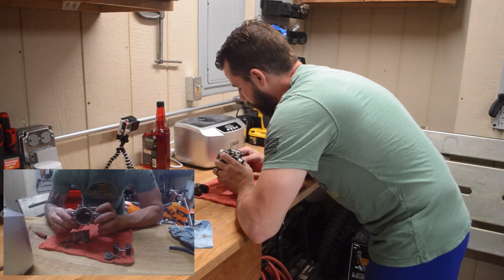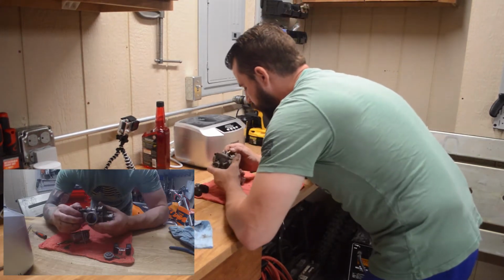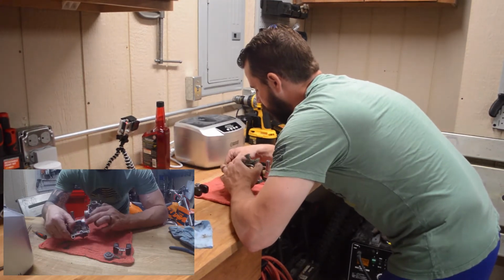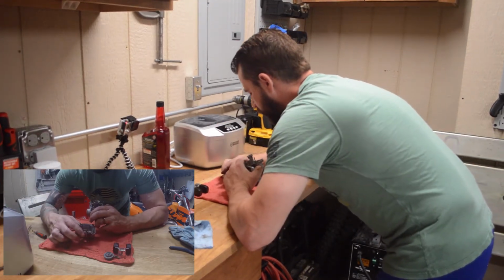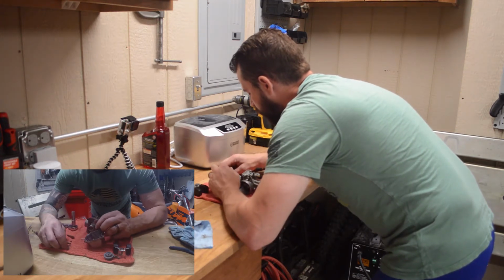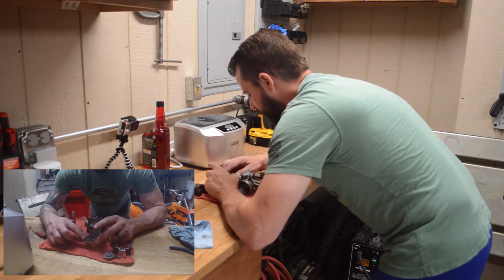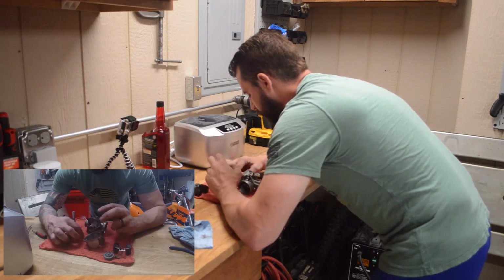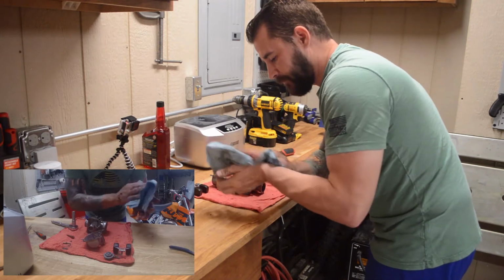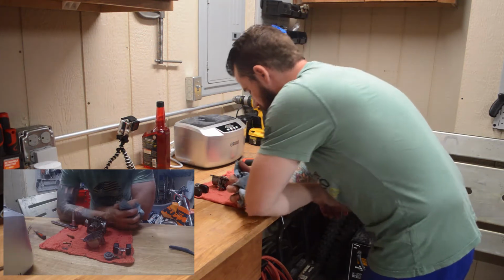So what we'll do, I guess, is we can put all of these little parts, rubber parts, seals, yada yada yada, inside of here, and it won't cause any damage to those parts. So really, we don't have to worry too much, whereas maybe some cleaners might be corrosive to seals and stuff. We're just going to use soapy water to clean this, because aluminum's funny in that there's a lot of chemicals out there, Simple Green actually being one of them, that's corrosive to aluminum.